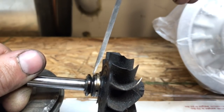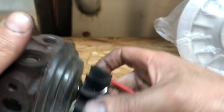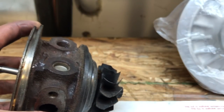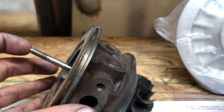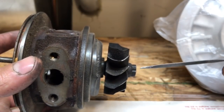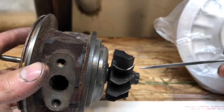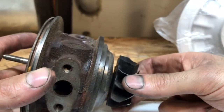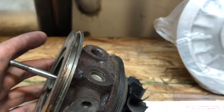If you do stick it right there and put it in, the way to go about taking it off is that it will be locked inside the bearing housing. You'll have to put this bearing housing in a press and have the press pressing on this, and you don't press it out, you just hold tension on there. Then you take a socket or a wrench and wind this off, and if it starts to lock up, wind it out the other way. This makes sure that the seal is coming off smoothly as the press holds it in position. That's one way that you can get that seal out.